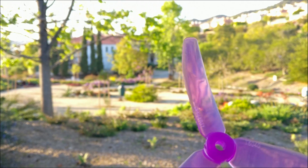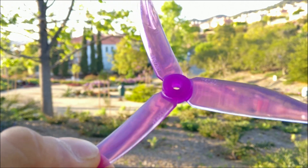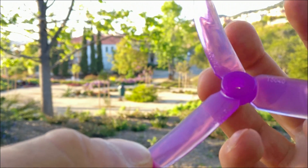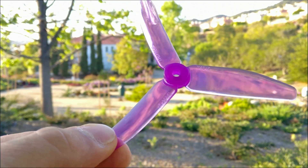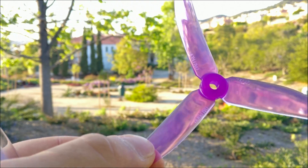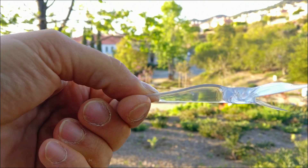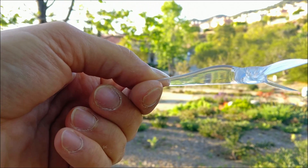What the racecraft props have done is made the taper on the prop at the end very drastic, so the end of the blade has very low drag. I think that once you get to a certain RPM, the center of the prop starts taking over in terms of thrust creation and actual punch. Now let's look at the Buttercutter. What they've done is added a pretty drastic scoop in the middle and they're calling it a 5-pitch. I have no idea if it's actually a 5-pitch, but it looks like a pretty significant scoop.